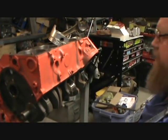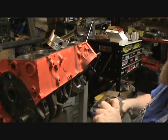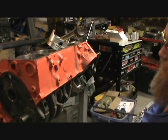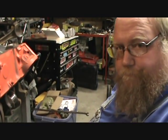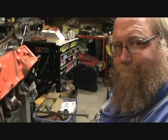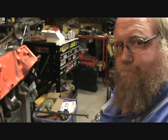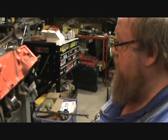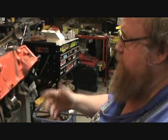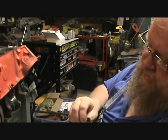Since the camera's been on, I had a guy here with a Toyota that we had to fix his windows - he tried a new window switch and everything and it didn't work, and come to find out it was a bad fuse. Anyway, we've had some more surprises here - things are starting to look better. I've already changed out the crank. I put the 400 crank in - this is a standard 400 crank, it does look pretty good. I'd like to dip it in the Evaporust if this ends up working.